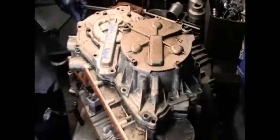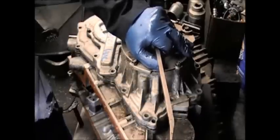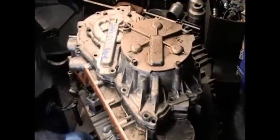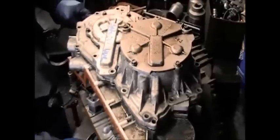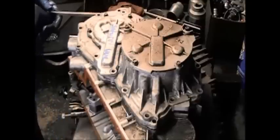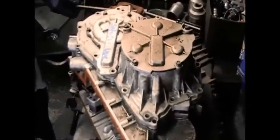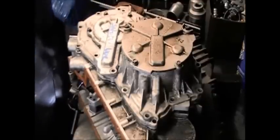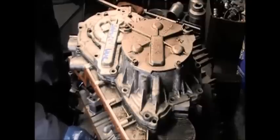And why these dealerships make things like that, I originally thought they were stupid, but that's not it. They might be smart because they break often. They don't even get it right. In fact, if one rebuilds a CFT 30 transmission, you can have everything right, but the valve body is the thing that will be bad. And when you buy a valve body from the dealership, you have to have the valve body flashed, because the computer is right on the valve body. So that is another way they try to make money with that CVT. It's not uncommon to get 3 valve bodies from the dealership, because the other 2 that you got originally are bad, that they rebuilt.